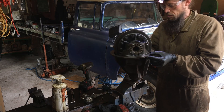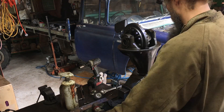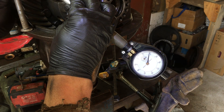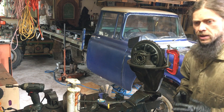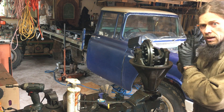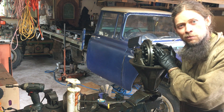I've cleaned it all up. The pitting is very minor on the teeth, tiny bit of lash — my best guess at 0.15 to 0.25 of a mil. About 0.1 lash in there at the moment; I've got the lash to 0.15, and the spec is 0.15 to 0.2 of a mil. I've been cleaning it as I've been going — it's pretty good. So I think I'm going to reassemble it and get it in, although there's a bit of gasket material cleaning before it goes in. Then we'll get the last few gears in and get under that truck.